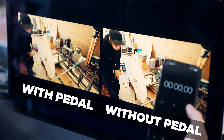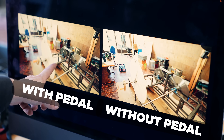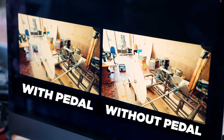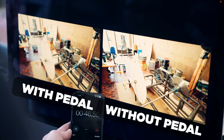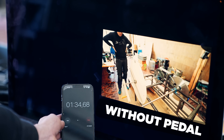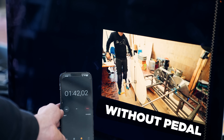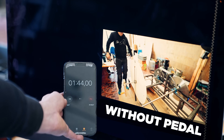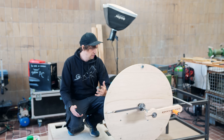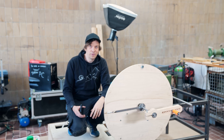I'm going to take the time when I release it. Over here we have the pedal, and over here we have the pedal disconnected. I actually thought the pedal would stop much sooner than this. Pedal has stopped there. Wow, it doesn't make a difference - I would never have thought that. They stopped at the same time! This pretty much shows you the importance of making empirical tests. Turns out the pedal isn't taking energy from the system.